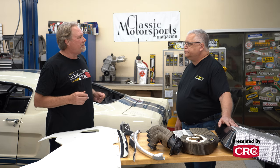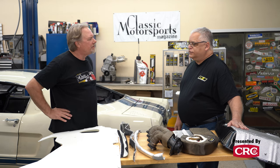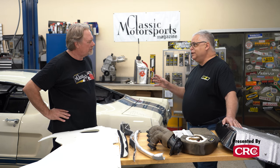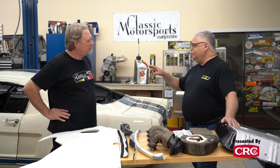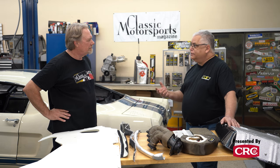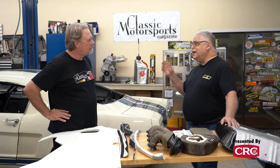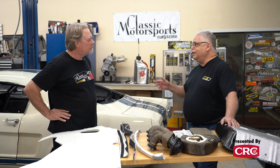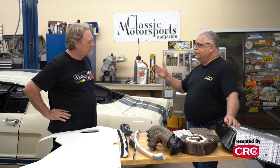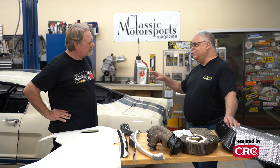What are the major heat problems that you see in vintage race cars, and what products do you have to solve those problems? In vintage race cars, particularly road racing cars like this, the biggest thing as far as heat goes is driver comfort. The footwell gets very hot — the headers run right alongside it. So you're trying to manage temperature in the footwell, transmission tunnel, and lines running front to back: fuel lines, oil lines. The motor generates a lot of heat and all the insulation is pulled out, so you focus on areas that make a difference to the driver and the performance of the car.